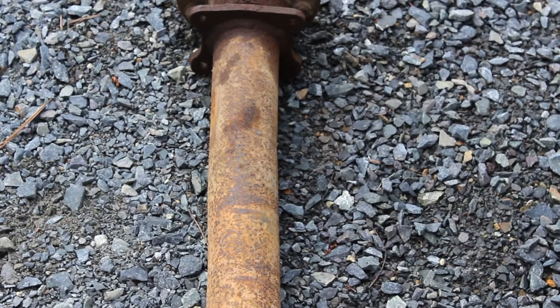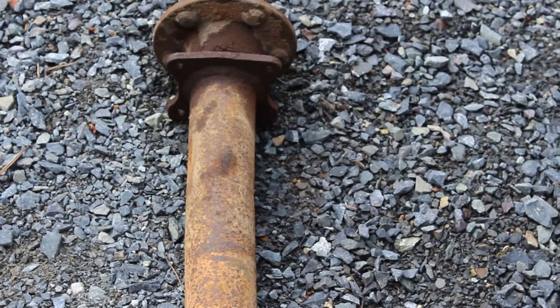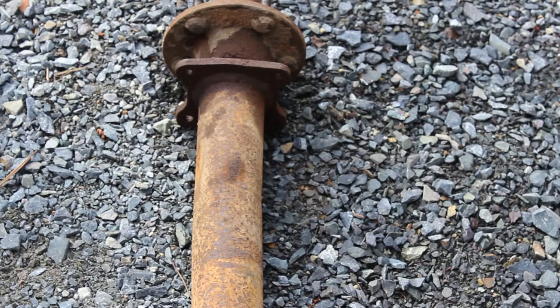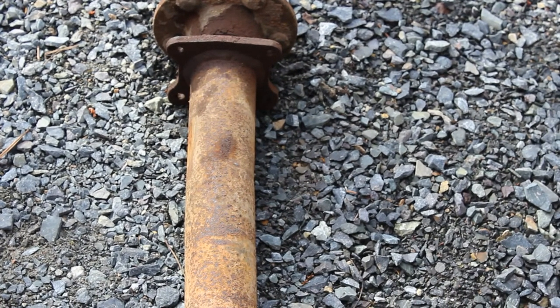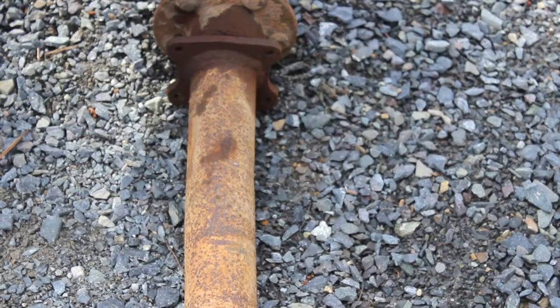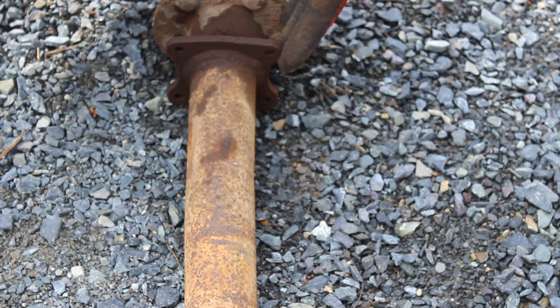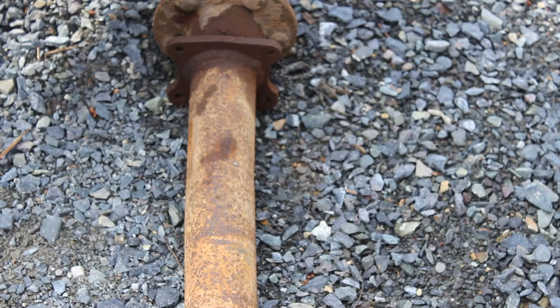And that little bit there, that's probably only about 5 mil on the actual axle bent. The difference between here and here is probably only about 5 mil, but if you were to continue that line, if you drew that line a meter further past this, then that would be really exaggerated. So that's what the problem is.